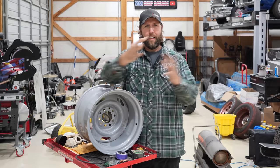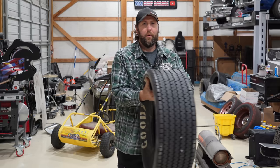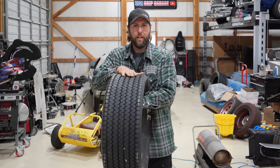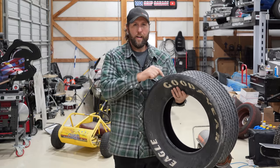Yes! So here we are. These are legitimate old school Goodyear Eagles. Found these on the interwebs, got a good deal for them. Now, they're not traditional slicks, and that's for safety. You put four slicks on that car, you go down the highway and hit any amount of moisture or loose dirt or gravel, well, you're in the ditch. Luckily, there's 2 miles of ditch for every 1 mile of highway, but we don't want to take that risk. So this vintage Eagle is going to work great. It's got some nice groove or a pattern in here, but of course the outside has that original looking NASCAR stock car look. So after I get the wheels painted, I'll get these puppies mounted on, but you're not going to see that until the wrap's done and the car's back here.